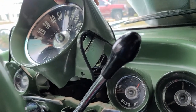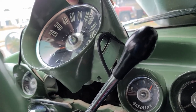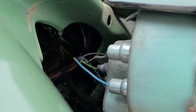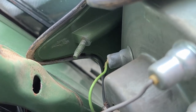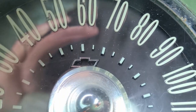Using both hands carefully to avoid yanking old cables. For reassembly reference: on the left side of the speedo there's gray on top and light blue on the bottom; on the right side gray on top and darker blue on the bottom; and top dead center there's a bright green, which I believe is the high beam indicator that lights up the little Chevy bow tie.